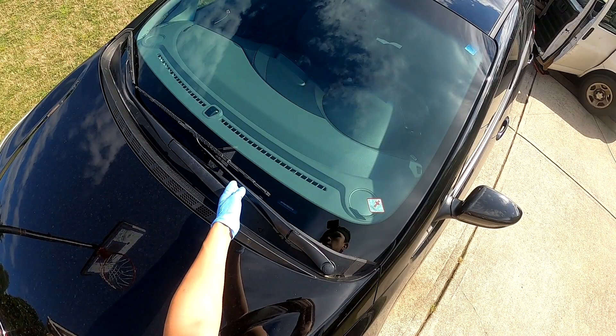That's about our first video ever — hope you guys enjoyed this tutorial on how to do a windshield replacement on a 2014–2018 Kia Forte four-door sedan. Luckily this windshield had no attachments like lane departure or range sensor. If yours does have lane departure or range sensor it will be a little different when disconnecting or removing it from the windshield. If your windshield has a condensation sensor, just remove it — don't disconnect it — and use a little bit of double-sided tape or urethane to glue it back onto the new windshield. Make sure you like and subscribe — we'll be dropping videos every Monday, Wednesday, and Friday on different types of vehicles. Appreciate it, see you guys later!